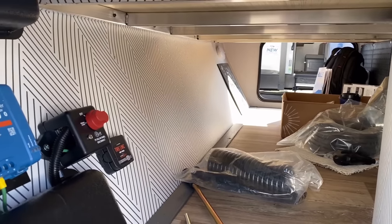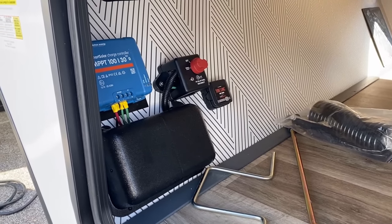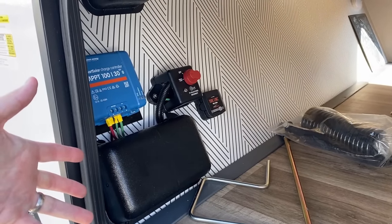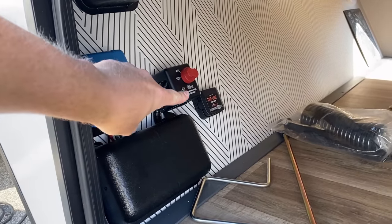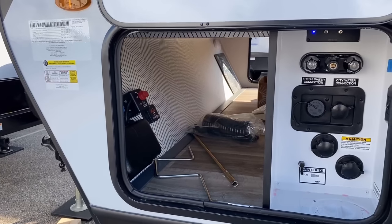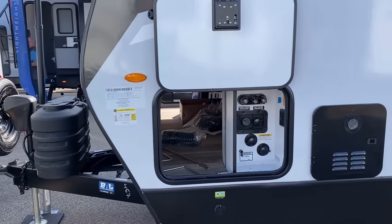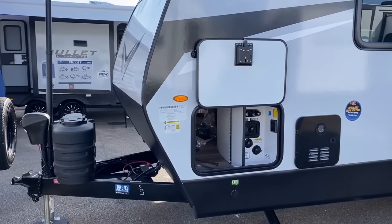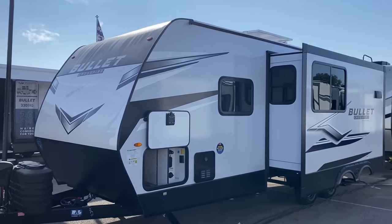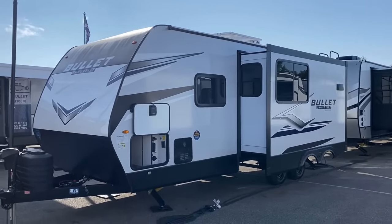Sliding over to this side — you've got a solar disconnect separate from your main house disconnect, to make sure your panels aren't accidentally cooking the charge controller if you don't have a battery on it. They're prepped for TPMS, and they now have a 30-amp charge controller absolutely standard on these instead of a 15-amp, which goes along with a 220-watt solar panel on the roof instead of the previous 200-watt. They've actually bulked up not just the base solar package but every optional solar package, getting basically 10% stronger.